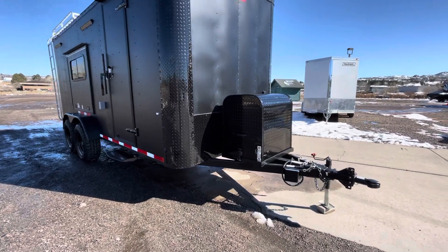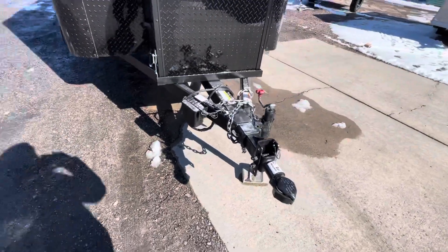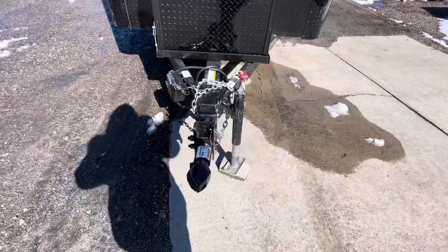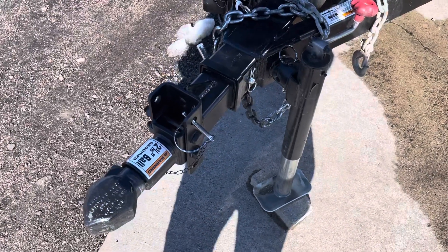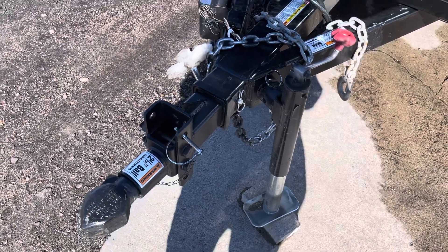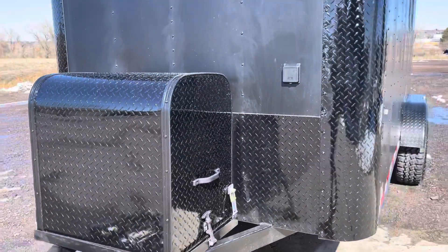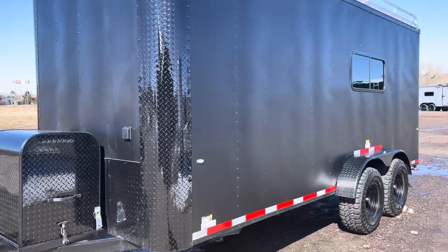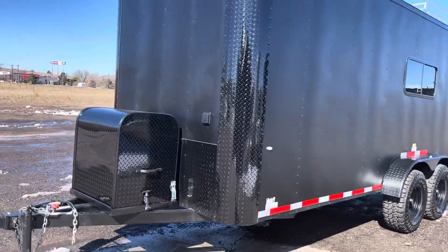You've got a place for a generator to be stored up front. We also do the side swivel jack to get that out of the way. The removable front coupler is a really great feature — if you want to add an articulating hitch, this entire end piece pulls out and removes, which is also great for anti-theft. You do have a twist lock plug on the front, and this unit has 30-amp service.